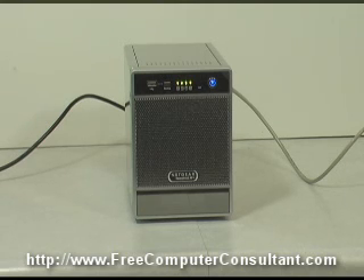Now this is the default configuration. There is another configuration that I kind of like for certain data situations, where you can have a RAID 5 configuration with three of the drives, and the fourth drive can be a hot spare that will jump into action should one of the three primary drives fail. When you do that, you do cut down the available storage space to only one terabyte instead of the 1.3, and actually it's a little bit less than one terabyte due to the overhead.